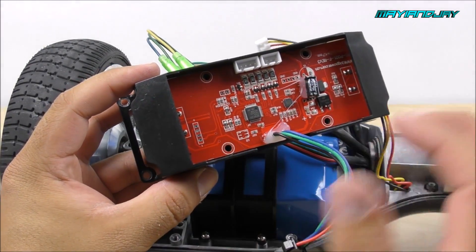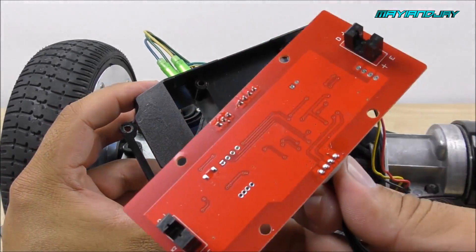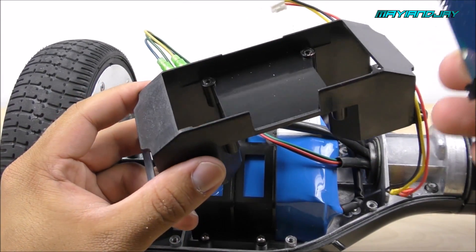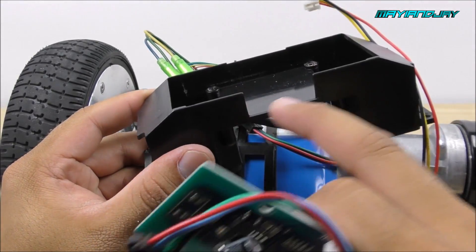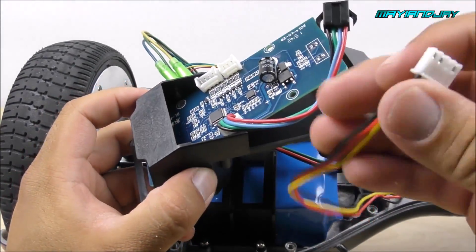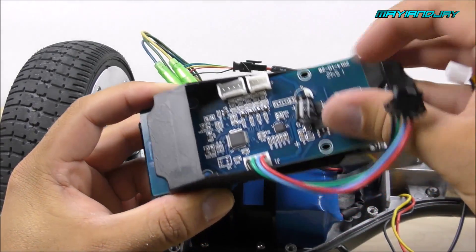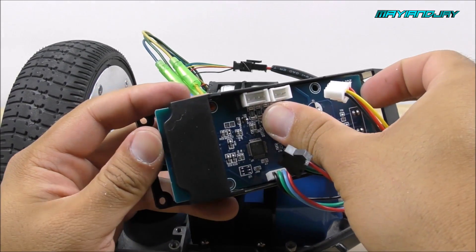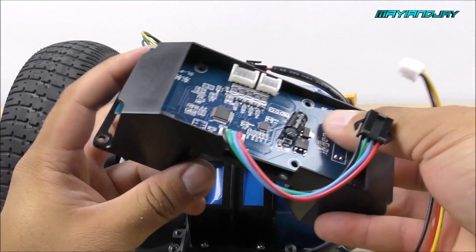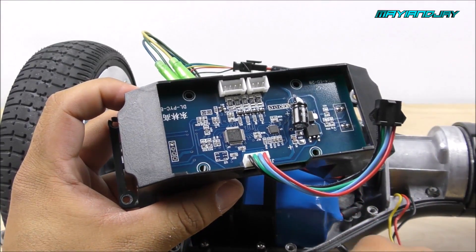The next thing you want to do is remove four Phillips screws to detach the old gyro. With all four screws removed, drag it to the side and push it out — this is the bad one. Now we're going to replace it with the good one. Make sure the wire is facing the little cut you'll see on your plastic. Don't put this in backwards otherwise you may cause more issues. Also, this needs to be calibrated — I'll show you how in just a moment. When placing it, don't grab it by the cylinder or you might desolder and break it. Align it with all four holes and screw it back in.